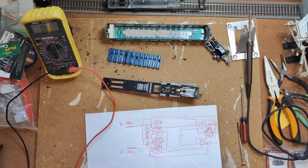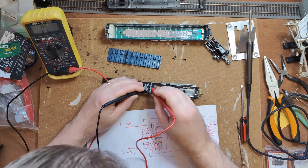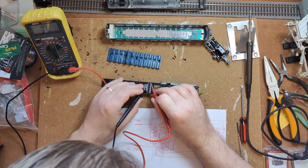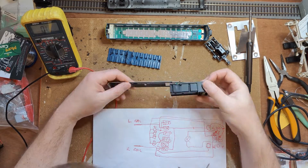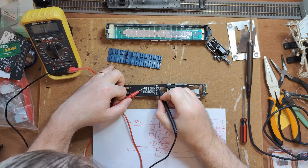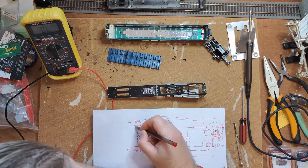I have had a go at this board previously, but my multimeter ran out of battery, and I had to stop before I'd finished working out all the connections. There are several diodes, resistors, and capacitors in the middle of the PCB. Four diodes can be put in a diamond pattern to make a full-wave rectifier, and what I initially assumed was going on was that four of these were being used as a full-wave rectifier to connect the carriage lighting to the pickups full-time. That's not really the case, or at least not in a straightforward manner.